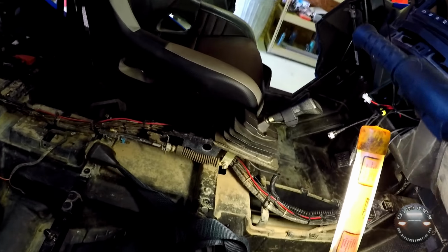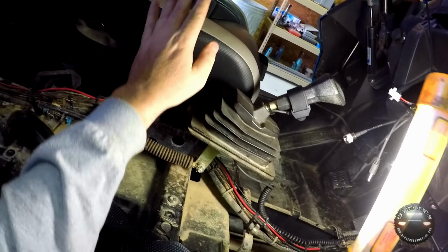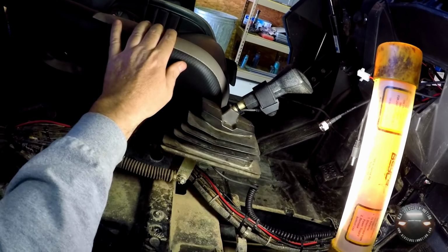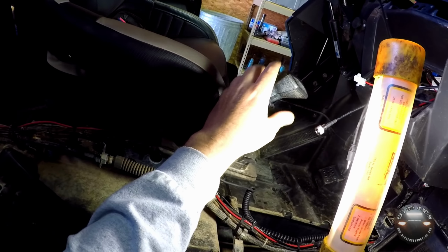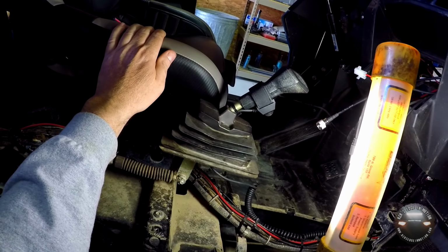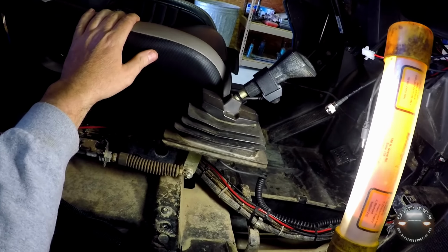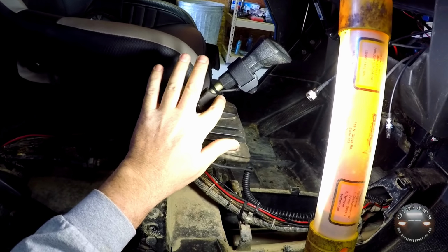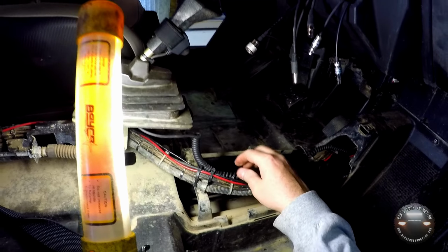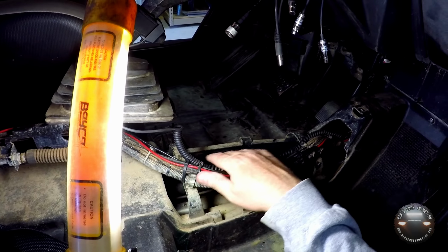For mine, usually these are supposed to go on the steering wheel, but in a race where you need instant access to your crew or trackside, that's absolutely the best solution. But our pace is a little more leisurely, so I actually decided to put it down here on the shifter. You can just stick your hand down here and squeeze that button just like you would a trigger on a joystick or something. I put a little notch here in the rubber boot and ran the cable down through it. The spring cable actually allows this to rotate around the steering column back and forth without getting tangled up. But it works just fine down there too.